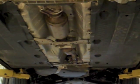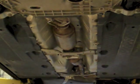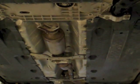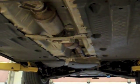I'm not going to spray too much around that heat shielding near the exhaust — I'll just leave that area. Anyway, there you have it, a little tour of the underneath. It's all back together and gooey. It really didn't take very long, and I'm very pleased to have that done. It took a little bit — not a whole can — of the interior frame rail spray, and three cans of the green stuff, the general waxy stuff. I hope that keeps this car on the road for a very long time.